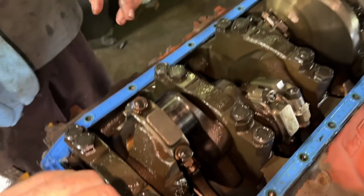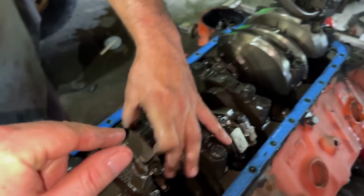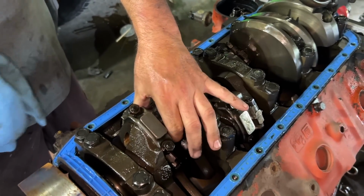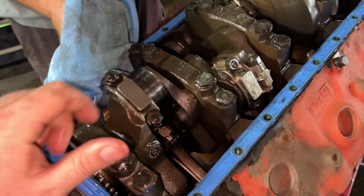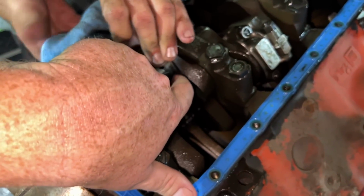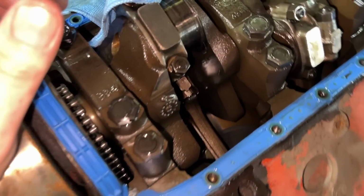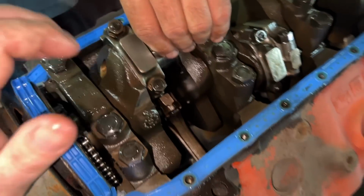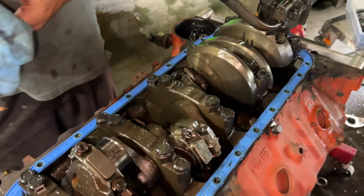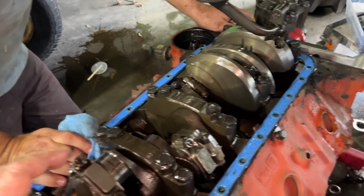All right, guys, so we found our culprit, one of the culprits. We definitely have another bearing back here that's bad, as you guys just saw. That's our issue. That's where all our metal's coming from. It doesn't look absolutely miserable, but the crank has definitely got some grooves in it. So either way, the crank was going to have to come out. Rod's held up. 4-bolt main block, though, which I don't know. That's pretty common on a 454. I don't know. We don't seem to think so, but...